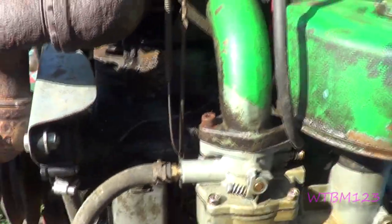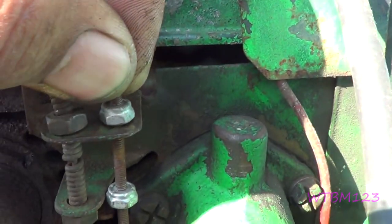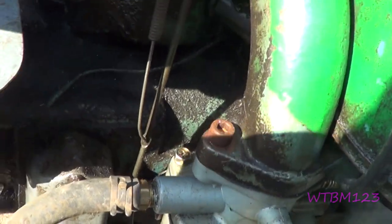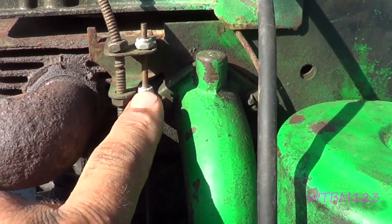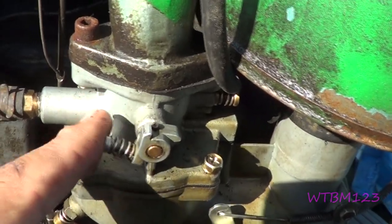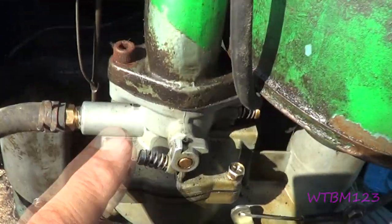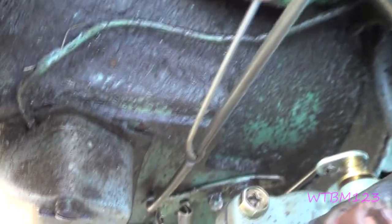Now if it's not going closed, usually it's because of this top nut right here. Just say the nut is sticking all the way up, not touching that, and this isn't going all the way down — then I would loosen this one and tighten this one to draw more cable so it could push that governor rod down farther. So in a way it's kind of simple: this is your low speed, this is your high speed, and this is your curb idle. You want to adjust your idle off of this. If it doesn't go closed when you put the throttle down, you'll have to loosen this nut until it closes down here. And if it starts getting a gap because you don't have enough adjustment here, then you got to adjust that cable down — see where it kind of hooks in together right there, see how the cable hooks into the rod.